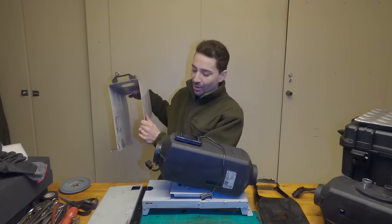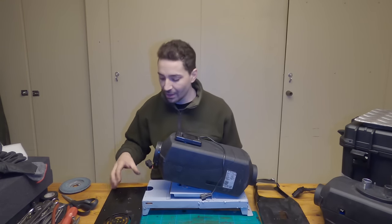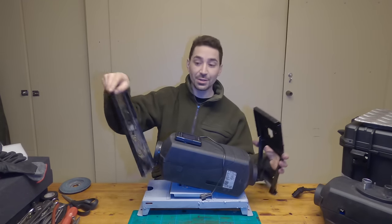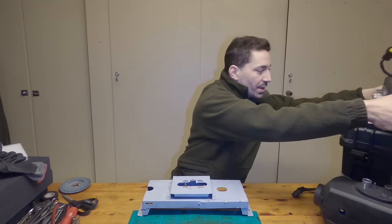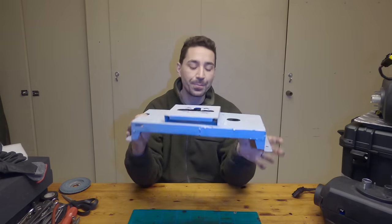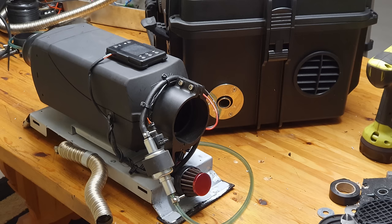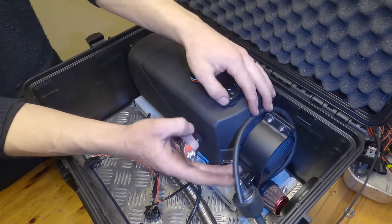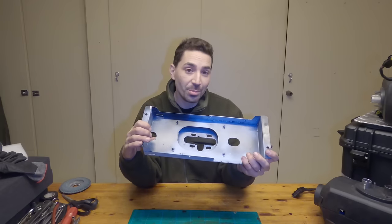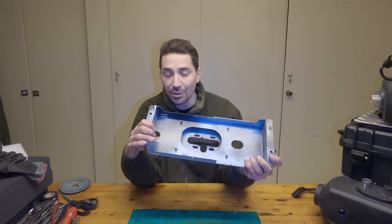So I've taken this bit off, removed the tray on top that holds the fuel tank, and taken away the two sidewalls that give the unit structure. You can unbolt the diesel heater unit and end up with just this bottom bit here. I've cut a small slot there that's going to be for the exhaust. We're going to mount this inside a Pelicase-style box — basically build the unit into something quiet, with insulation and heat shielding, making it self-contained and weather resistant.